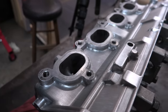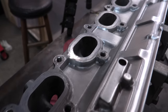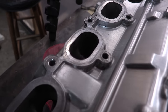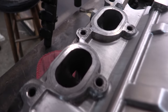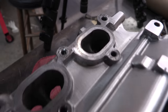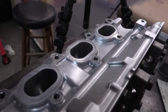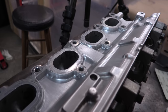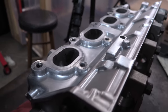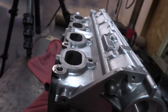There are a few Swiss cheese holes around the exhaust flange in this casting that I can't do a whole lot about without really distorting the shape of the flange, so I'm leaving them there. But you can see how I've dug out all the corners evenly, all the way around that flange. The flange is something I saved for after the scale layer cut until now, because I wanted to leave as much meat as I can here. I like how this one's turning out, and this is really going to pop after step four. I'm still keeping things nice and flat, with a good uniform texture, and the colors are even.